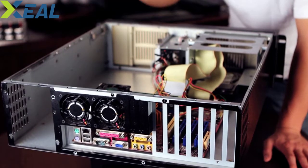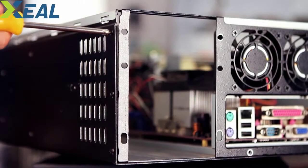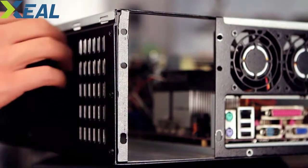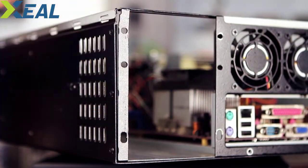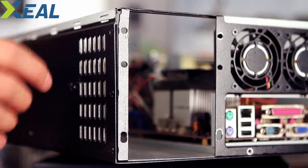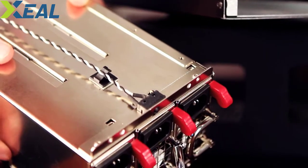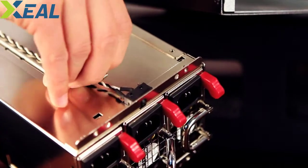We're going to go ahead and install the redundant power on this model to show you exactly how it will look once mounted. First, I unscrewed — or untightened — the screw sets here on the side wall that secure the wall of the chassis to the back plate. By doing this I give it some more space, so when we slide the power supply into the slot it won't bump into the ends of the screws. I strongly recommend removing these so they don't get blocked by the chassis.